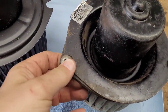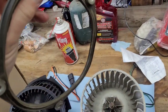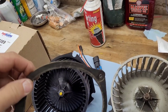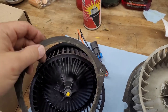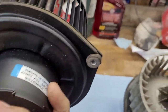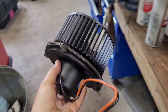You will have to take this little gasket off the old motor and reuse it, because the '97 through '01 Cherokee does not have one of these type of gaskets. Let's put that on — and that's what your gasket looks like. Make sure you have the metal part of the gasket on the exterior so the heads of your bolts will be flush up against it. This is probably one of the most simple repairs I'm going to do on this. Let's go put it on.